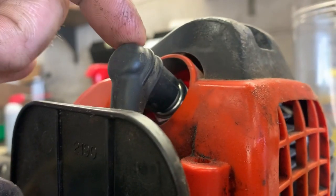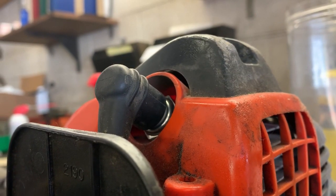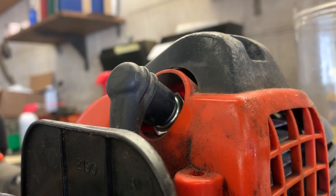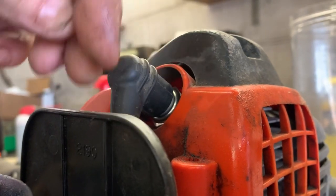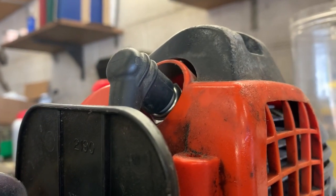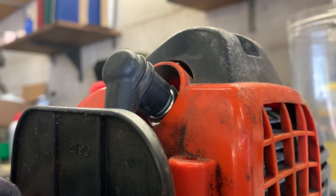You can tell from that short video clip we got some definite bleed-over from the ignition system. Let me show you why it's doing that — it could have a compromised spark plug boot, but a lot of times these trimmers are susceptible to trailer trauma, and these plugs stick out pretty far and can hit other equipment.